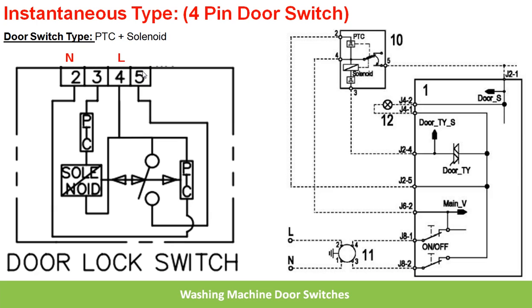Through this fifth pin, the voltage is applied to the further electronics of the washing machine. After the completion of the washing cycle, or whenever the user presses the pause button, two impulses are applied to this triac, and this switch is designed in such a way that it opens instantaneously — there is no need for any waiting time. This is the advantage of this type of switch. Whenever the user wants to add additional clothes, they can pause the washing machine, open the door instantaneously, add the clothes, and start the machine again.